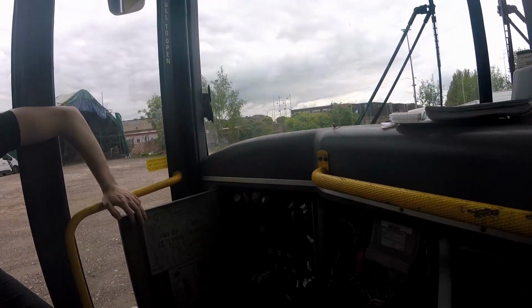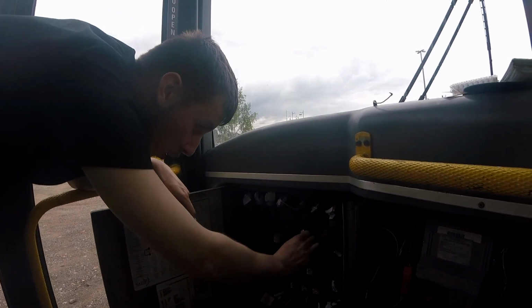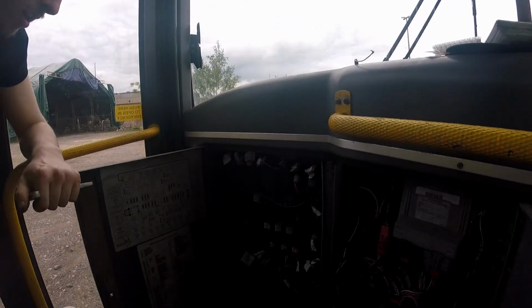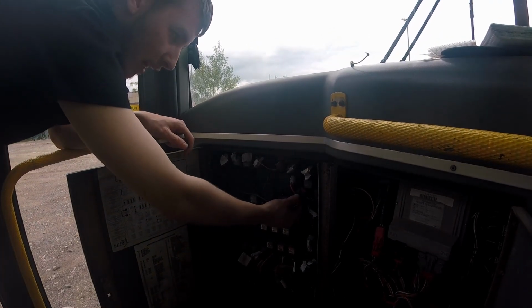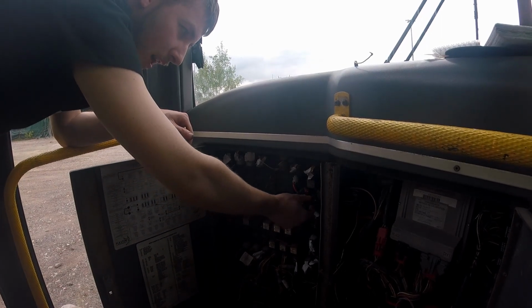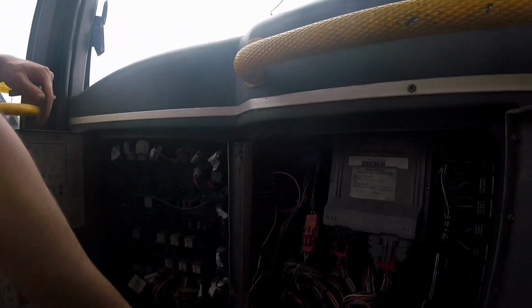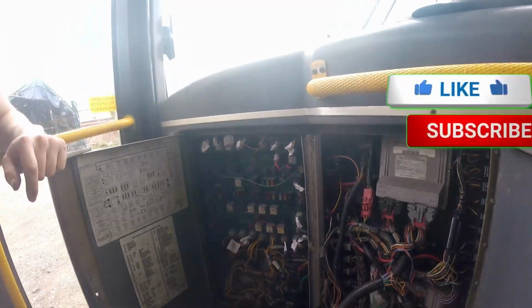I found a 24 volt switch feed that, when the ignition is turned on, is on a spare plug that's used for a Volvo only. That slot there will produce 24 volts when the ignition's turned on. So I've wired that into a fuse just to cover our backs in case that rear one comes off. Then got that into a connection block, which then splits off into the two, and then goes down to the fuel pump at the back. I just thought of one issue.